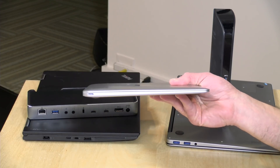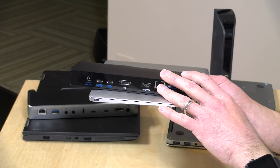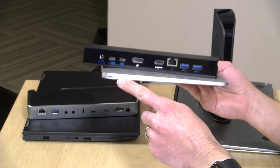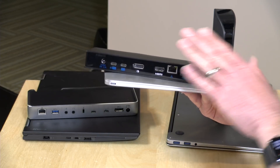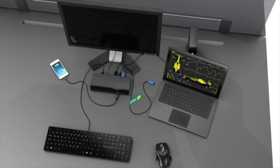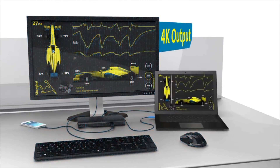That leaves us with USB Type-C, and I've got one little laptop here from Apple — the little MacBook with a single USB Type-C connector on board. For this I would recommend the Kensington SD4600P. This laptop cannot work with Thunderbolt and will not work with the Thunderbolt dock. Even though the port looks the same, it doesn't have the Thunderbolt circuitry inside, so your only option is the USB-C dock. With the SD4600P you'll get all the benefits of USB Type-C including the ability to connect a 4K display along with all your USB accessories, and you can charge your notebook with a single cable.